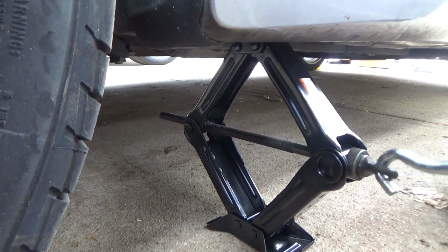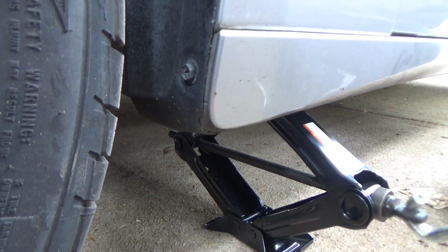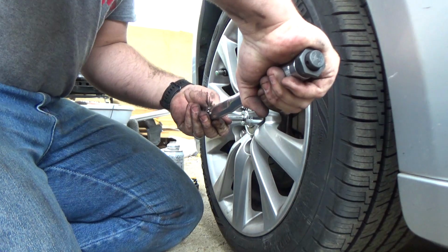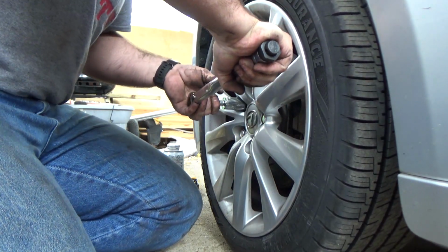And this is a Lexus, so torque your lug nuts to 76 foot-pounds, or don't. But keep in mind that another cause of warped rotors is improper wheel torque. Also, there are several engine, drivetrain, and wheel options on this car, so refer to your manual for these torque values.